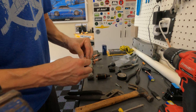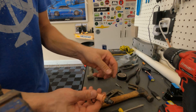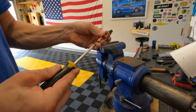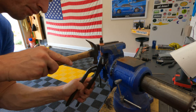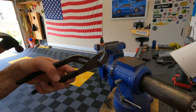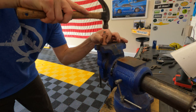Next injector — get it prepped. I noticed this one is missing an o-ring right here, but if I look in the fuel rail it's sitting right there, so I'll just be careful of that. Now let's go ahead and get the micro basket off of this one — get your screw started in there, don't force it too far. Grab a hold — there it is. That one came out much better than the rest. I know it's hard to see on the camera, but the micro screen looks very dirty, so it's good to replace these.